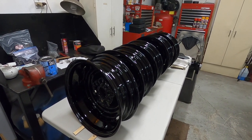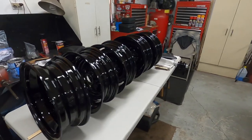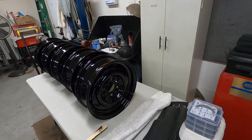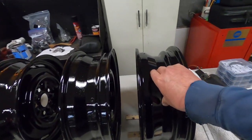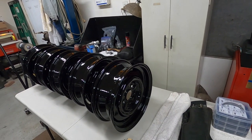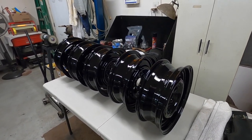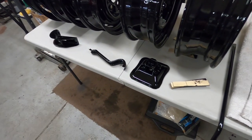The nights have been getting down in the mid-30s, so I set them up here where it's a little warmer. I have the heat set on 72 in the garage — I've just been leaving it there since I brought the wheels in overnight. That way these will be cured hopefully by Friday and we can have some tires on those wheels. It's acrylic enamel and that stuff truly takes about 30 days to cure to where you can buff it, and a good 60 to 90 days to really get hard and be durable.